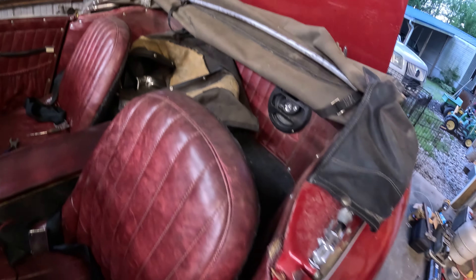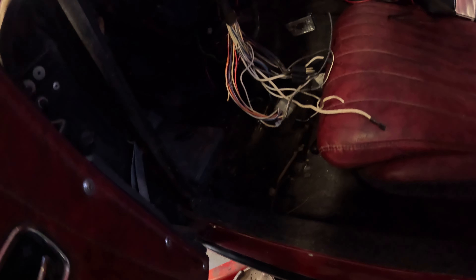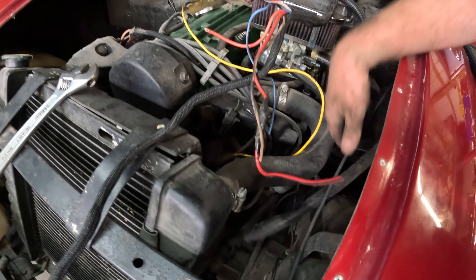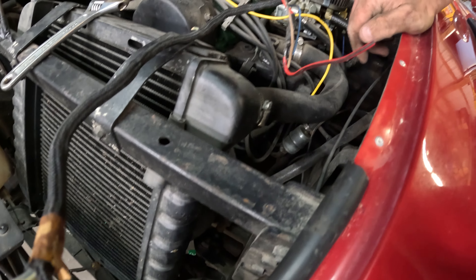What's sad is the original harness was loomed really nicely and in really good shape. It's just that someone repaired it a few too many times. Tomorrow the harness should be here, so we'll come back and start laying it out, get everything stretched out, and get everything ran roughly to where it's going to go. I'm going to try to run all the wiring inside the car to better protect it from rodents while the car's in storage, and from weather, driveshafts, and exhausts. The inside of this car is fairly simple, so we'll probably pull the carpet loose and run a single loom back along the transmission tunnel to the trunk for the rear lights.